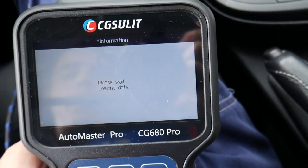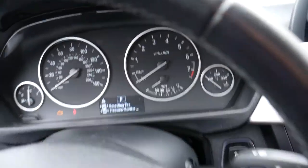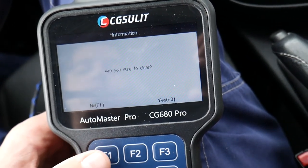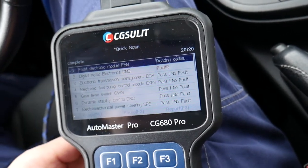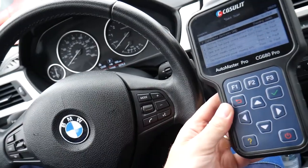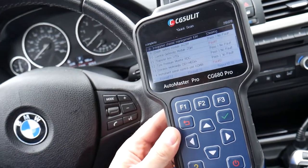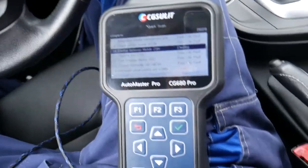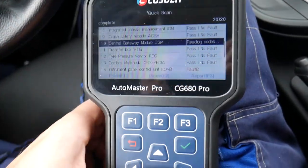Click clear codes — codes are cleared. It resets the tire pressure monitor system on the dash, but the codes will come back because we don't have TPMS sensors. You can also erase all codes at once across every system. This is especially important on modern vehicles after battery replacement — if you leave your lights on or a door open and the battery gets weak, you can end up with 20 codes because modern vehicles go crazy at low voltage. A computer like this is a must — each dealership visit costs quite a bit just to reset codes.